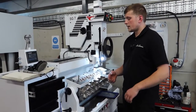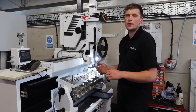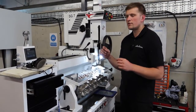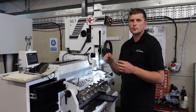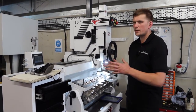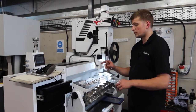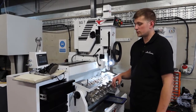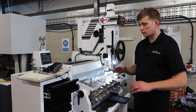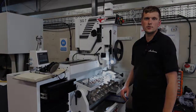With the seats all cut, the next process is to rotate the head, put all the valves in, and carry out a few more checks. From there we know where we are with the head. It's then a case of getting it on the bench for more measurements — we've got slight variances in the spring retainers and spring seats, which on these are built into the valve stem seal. By measuring all those bits we can pair the springs and get seat pressures near-on identical, which is what we want for smooth running, especially up higher in the rev range.